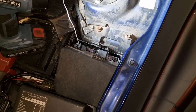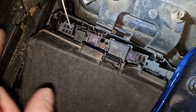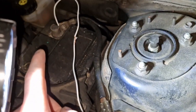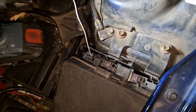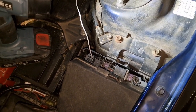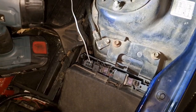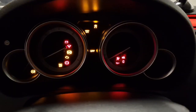After the oil change, you need to reset the oil deterioration level. So this is the fuse block under the hood. Just connect the right top pin to the mass, just find some wire here, it doesn't matter which wire. I just found this one. In the previous video on my channel, with the link in the description, I showed you how to do it using the ForScan application. This time I'm showing you how to do it using this pin approach. So connect it here, and then you need to switch on the ignition.